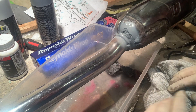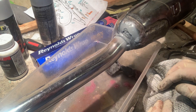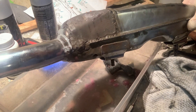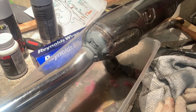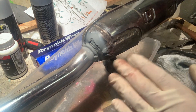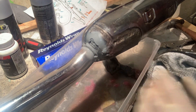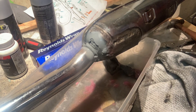I'm just going to try to seal the air out of this thing right now so it doesn't rust further. But again, long term, I think I'm going to have to take this in to get it welded. This whole pipe has been really patched up — you never know until you really start diving into something. So I'm going to let this sit, scuff it up, hit it one more time with primer, and hit it with some silver. Then we'll be good to go and I can continue polishing.